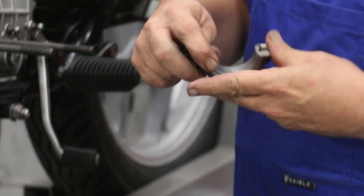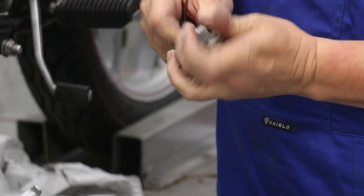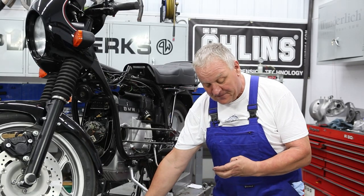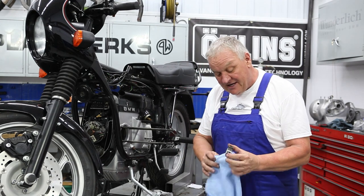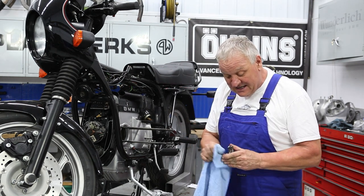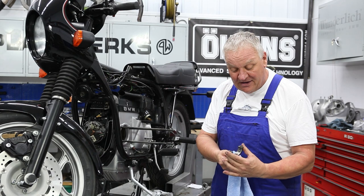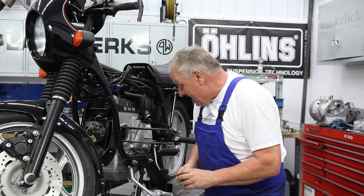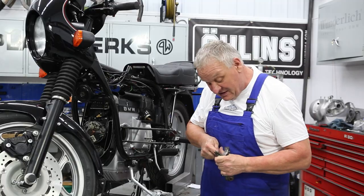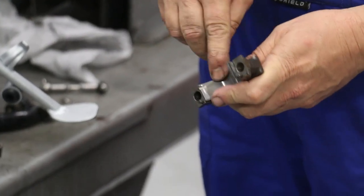You need to be very careful not to damage anything. Just sort of dislodge the bearing shell by pushing on the side of it and carefully pop the old bearing out. Then you want to clean everything very thoroughly using a lint-free towel to make sure you don't leave any debris. It has to be absolutely clean. I'll also clean them in the solvent tank and blow everything off. Push it slightly to the side — it moves up and pops right out without doing any damage.